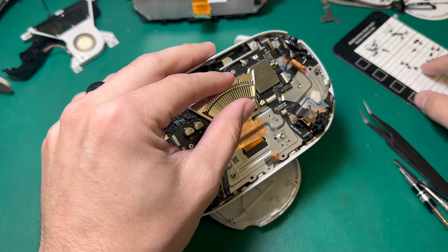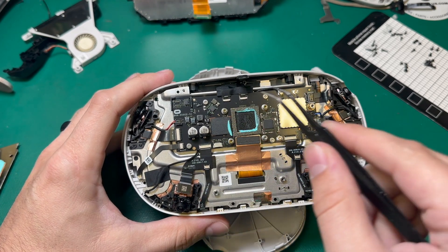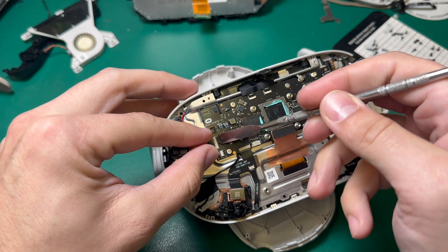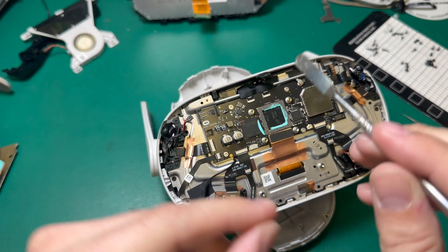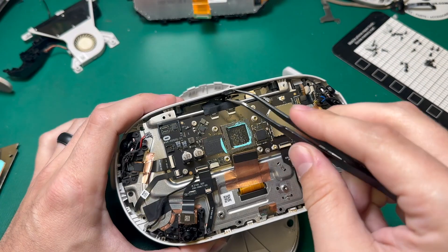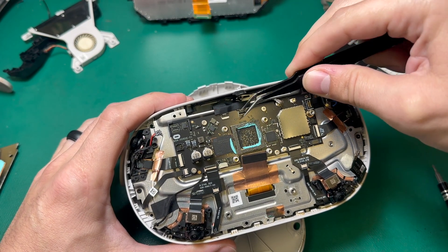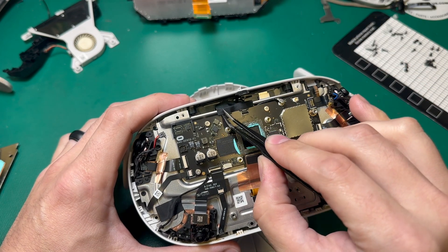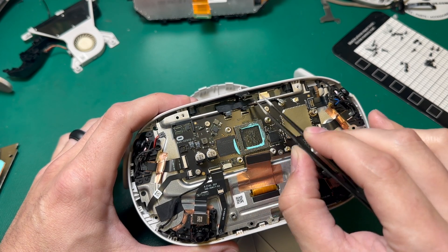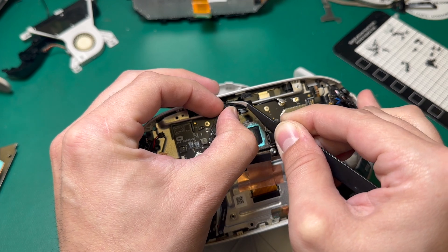After that I'm going to remove this heat sink. Once it's removed, I can start taking out all of these cables around the board. You don't have to do this in a specific order, you just have to be gentle. These ribbon latches are fairly delicate, so just be slow and easy with them and pull straight back. Try not to wiggle in or out too much, because the little plastic legs that hold the cables in will break off. There's almost always a little piece of tape that holds these two cables in, so I'm going to undo these latches and slowly pull back on both of them, and then remove the tape. Trying to remove the tape before the latches almost always damages the latch, so I try to avoid that.